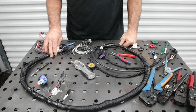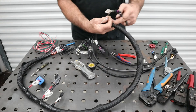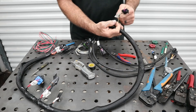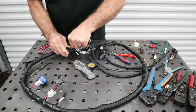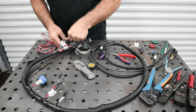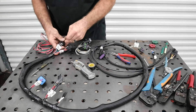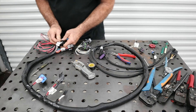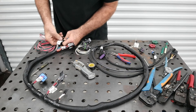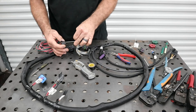We've now modified this harness. One thing we did was add a fourth wire for our input/output — now we have one input and three outputs. To add that in, you push this connector in and pull out the appropriate pin position. These connectors use pins and plugs to seal the terminals. When done, push the double-side down and it's locked — if it won't go in, check your terminals; one of them is probably not in completely.